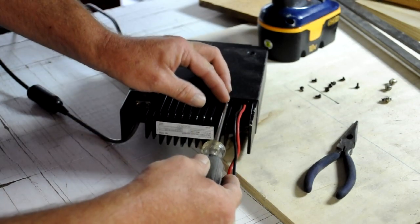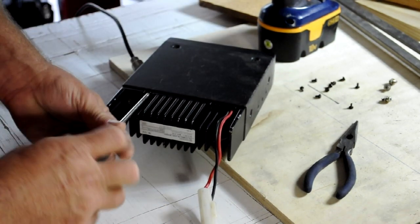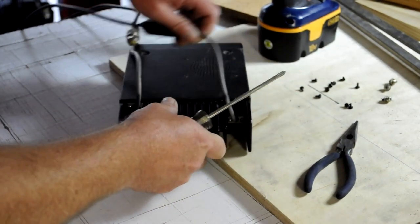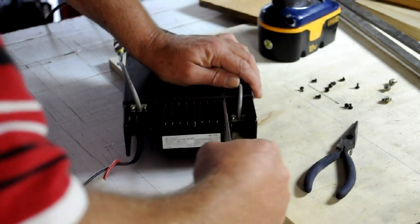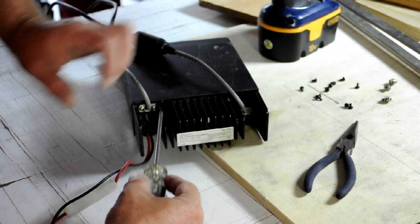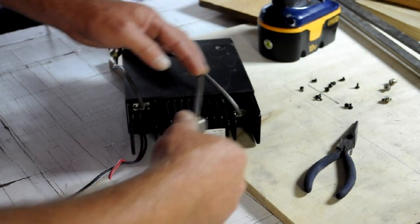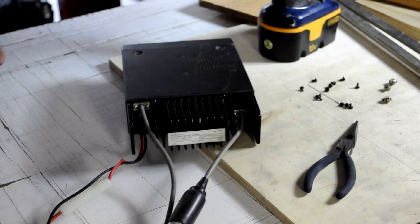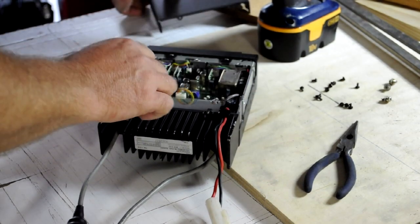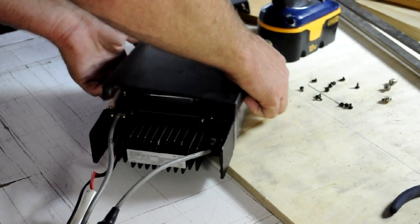But don't remove the covers just yet. You have to be particularly careful about the speaker wires — I'll show you why in a moment. Get the antenna connectors out of the way. We're going to remove the bottom cover first; it just slides right up, though you may have to wrestle a little with it. You have to be careful with the top cover because of the short speaker wiring — carefully tip it over.